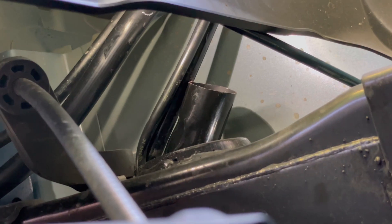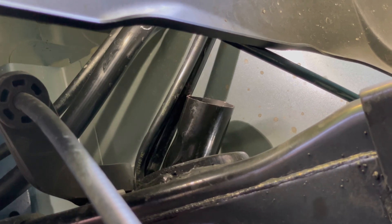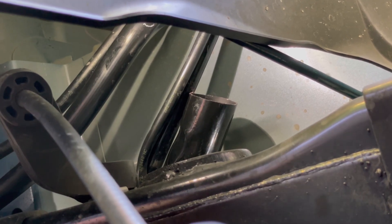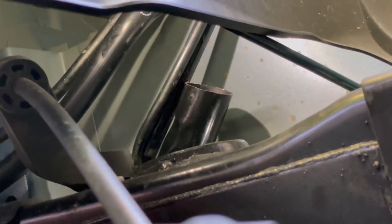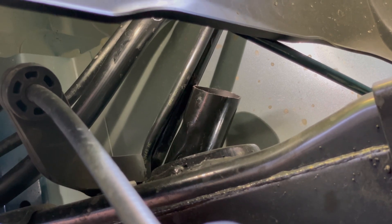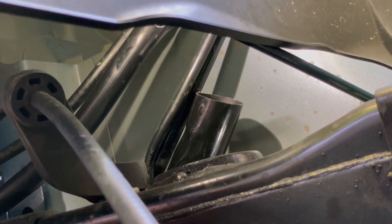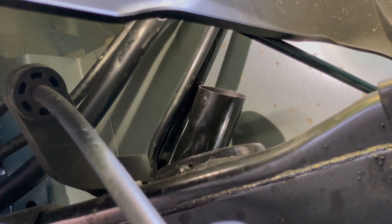You don't want all those metal shavings going down into your fuel tank and into your fuel pump. I think that's what happened to our buddy's truck — the fuel pump went out and there were metal shavings in the tank. We were worried his injector pump was going out too. I think whoever installed his didn't clean it out properly — that's actually what happened.